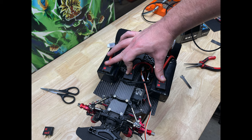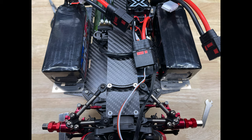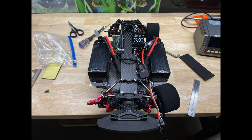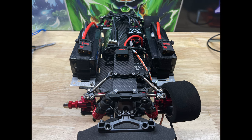Testing where I'm going to place all the wires once they are all hooked up and connected. It's really unfortunate that I didn't get to show you guys all of this in the video, and I can't show the car anymore because I've actually taken off all the parts — I'm going to buy another Limitless and this setup is going into the Limitless. I'm no longer moving forward with the Vortec; I've reached my personal goal with this chassis. These are battery trays from a Traxxas X-Maxx, actually made by WFO. I placed them onto the chassis, checked where I wanted to put the batteries, and drilled out holes so that those can fit. I ended up having to raise those battery trays up just a little bit so I can get the straps underneath them, but this solution worked out really, really well.